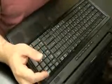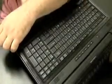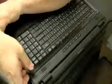Okay, so I'm trying to pull the whole top section off in one piece. It's very unlikely it comes off in one piece because that keyboard is in there pretty solid. It's probably screwed in somehow. I like to use my fingernail so I don't scratch any of the plastic to kind of pry the top and bottom plates apart. And they are coming apart, if you see that. But there's something still holding them in. In some cases, it might be a screw that I missed on the bottom of the computer. In this case, I don't know what it is yet.